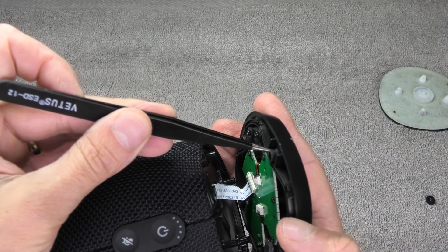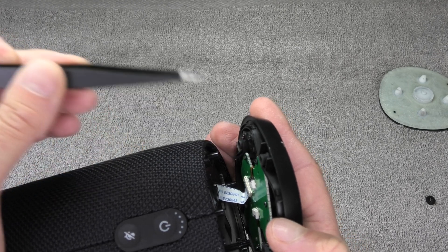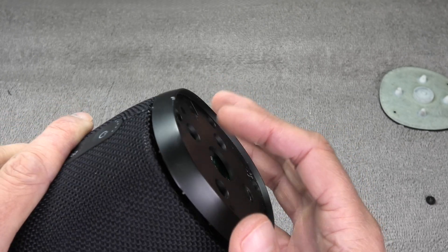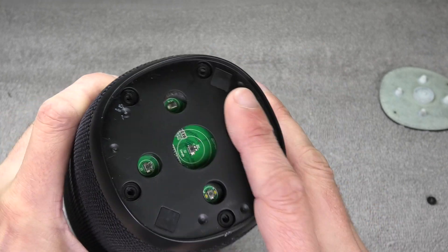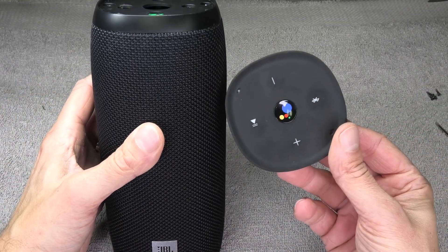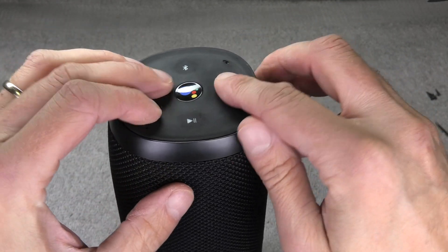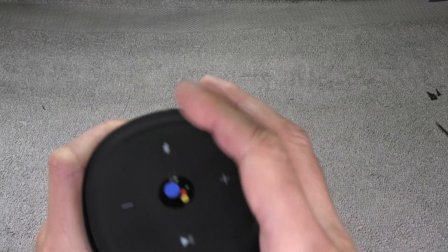Before I close the lid, I'm going to take a look at these rubber grommets. Each of the screws goes through these rubber grommets and then into pins on the opposite part. Make sure these rubber grommets go all the way over those plastic pins — it's relatively easy and should go quickly. If there's some resistance and the top cover doesn't want to go down, you know those grommets aren't sitting right. Tighten all the screws really tight, then put the rubber piece back on. You see the play button goes where the JBL logo is on the bottom — just press this on. The glue is still sticky enough that it stays in place, and I did not have to add additional glue.